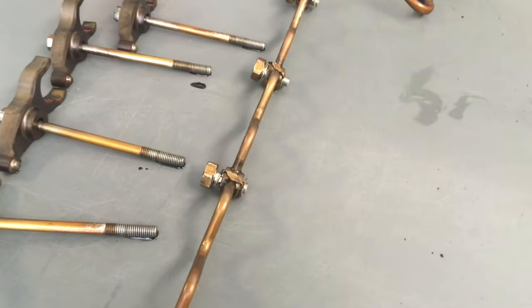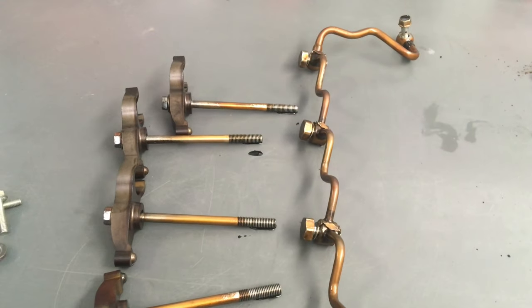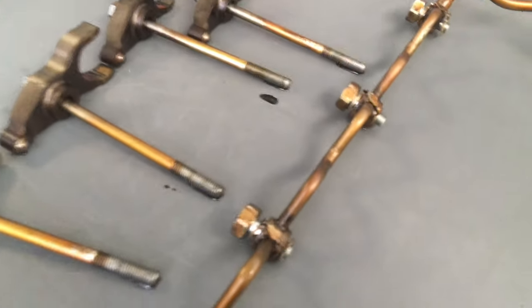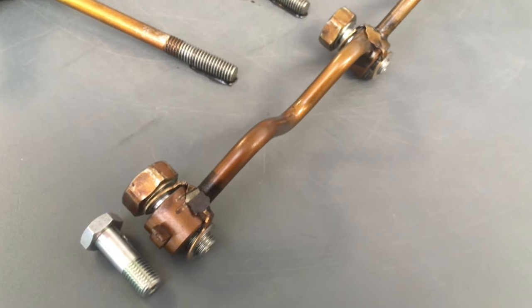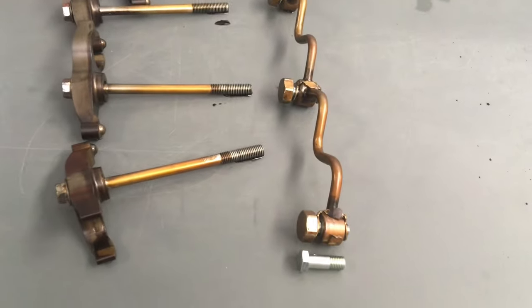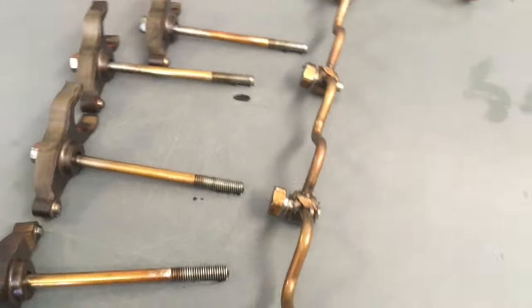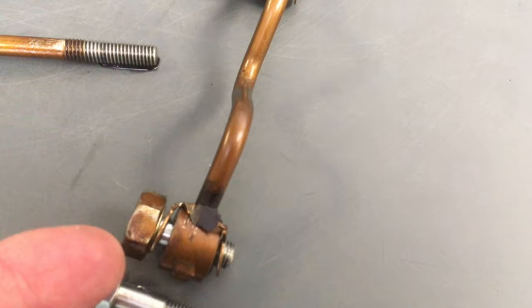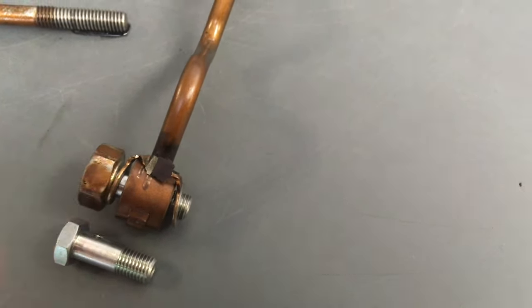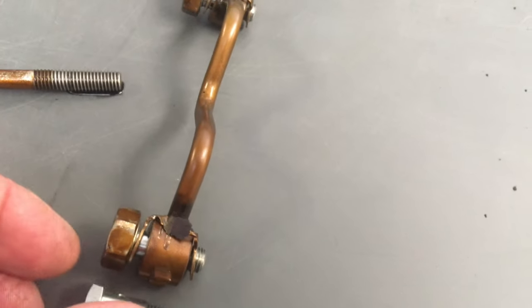Quite often they don't twist, but quite often they do twist at least one and it just does my head in. Even though I've had no leaks, never had a leak, never had a problem - I don't know how people have that problem. Careful where you go, like I always say. But this is easy prevention for 50 bucks, subject to availability. We've got quite a few in stock and more coming. If you're not worried about it, the old bolts will do the job - just give them a good cleanup, maybe a bit of wet and dry underneath the head of the bolt to make sure there's no little burrs that are going to grip on it. Make sure your washers are nice and straight.